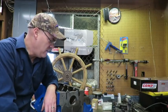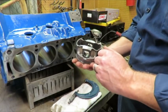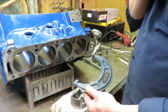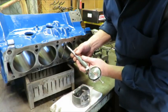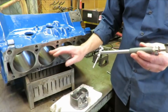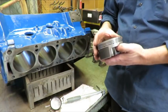The bores are the correct size and we have consistency all the way around. This block is in pristine condition, well within specifications — a really good candidate. We're using a moly forged piston for this build — it's a dish piston, really good quality. It is a stroker piston because we're putting the stroker crank in. We have about five thousandths clearance exactly where we want it — the bore clearance is exactly right. These are things that can't be overlooked.